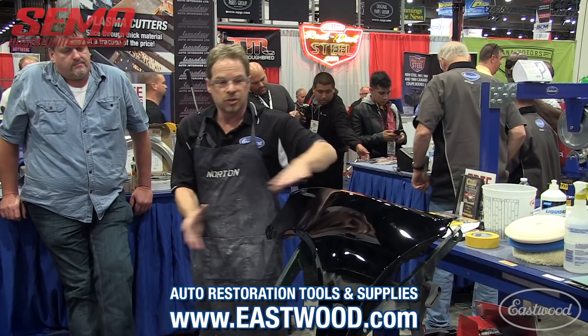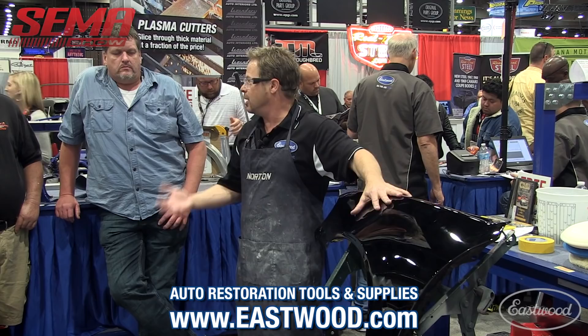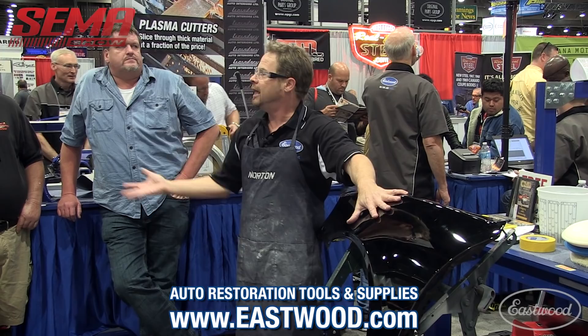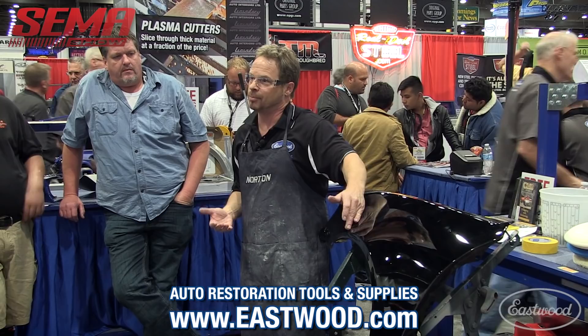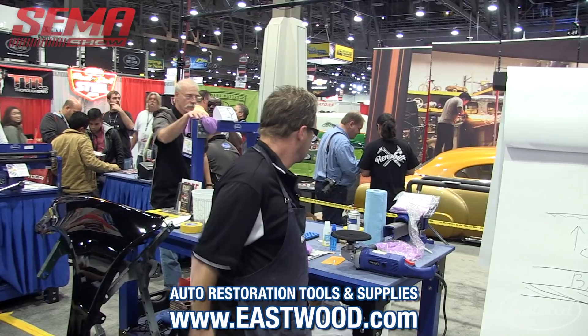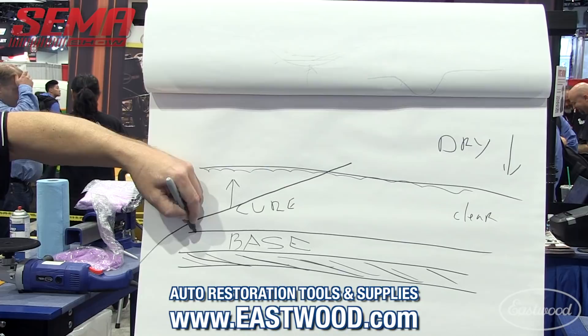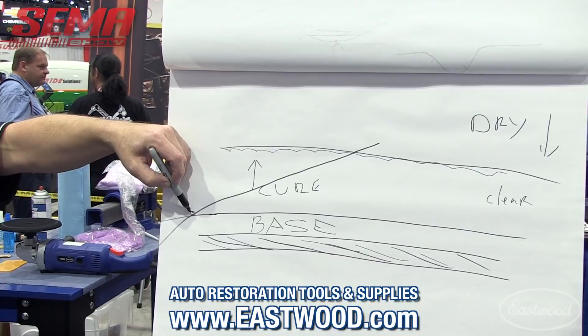I want to make sure that I don't burn through. When you're buffing, if you burn an edge through, it means you burn through the clear, you burn through into your base color, and you're going to see it. Especially with black it's going to roll up. If you've got a light-colored primer it's going to show up. It breaks your heart and you've got to redo — and it becomes a very sensitive area. When you burn through and then paint it again, solvents are very aggressive, they'll dive that area and you'll get a wrinkle, a lift right on those weak edges.